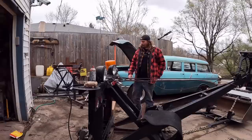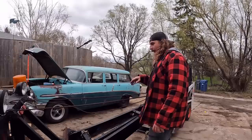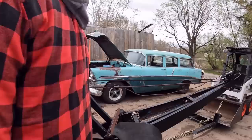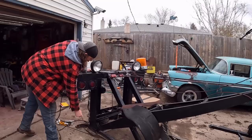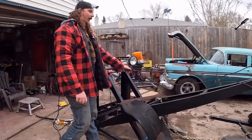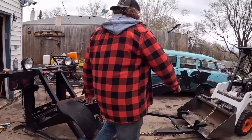There's no internet videos on old tow truck junk as far as I've seen, so here's a quick breakdown of how this works. There's one cable right here that runs to the back and that's what controls the height of the boom - you can raise or lower it any way you want. Mine had cables going down and chains going up with different hooks. I had this cable break once and it all comes down in a hurry, so replace this - it's like half-inch braided cable, good stuff.